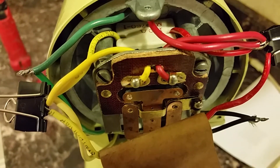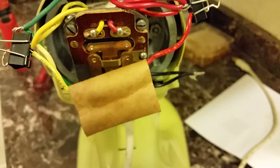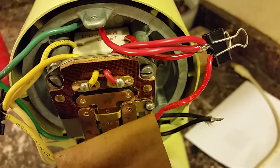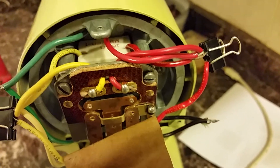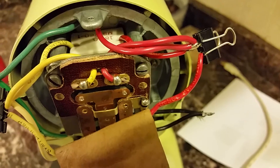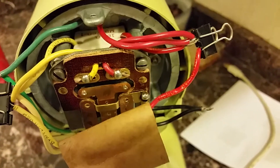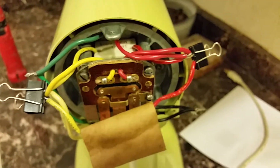When the points are open, the only source of power the motor has is through the resistor. Then there's the main motor winding wire coming in from the windings — that third wire at the top — and the fourth red wire is just the capacitor across the entire circuit. The yellows are just the corresponding other sides. It's all color-coded for easy assembly at the factory or by a do-it-yourselfer.